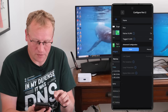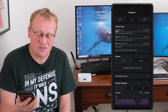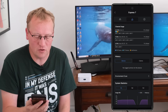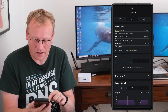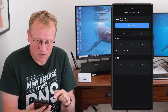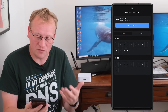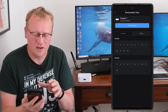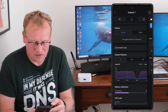You can name ports and do the same for port one. Under insights you can see how well each band is utilized — 10% on 2.4, 1% on 5, and 1% on 6. I'm not sure why 2.4 shows utilization with nothing on it — let me know in the comments. There are also logs and an environment scan. Pressing 'Scan Channels' will scan all 2.4 and 5 GHz networks, which is a good idea periodically since UniFi will massage the bands based on what's around you.